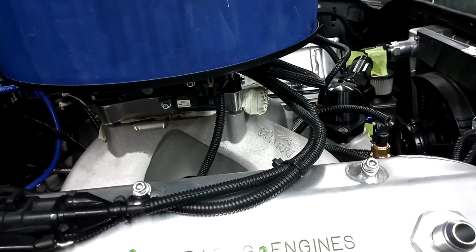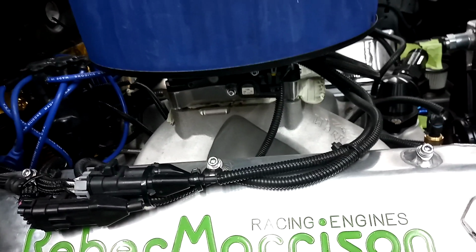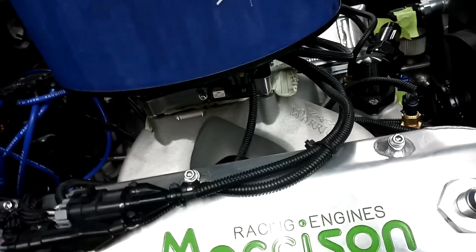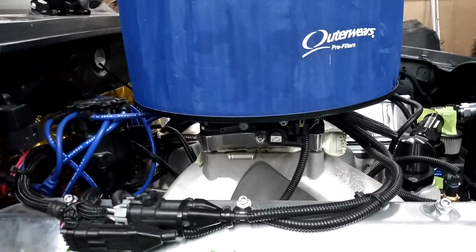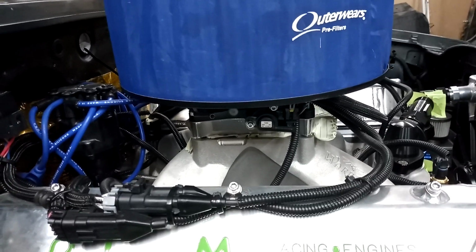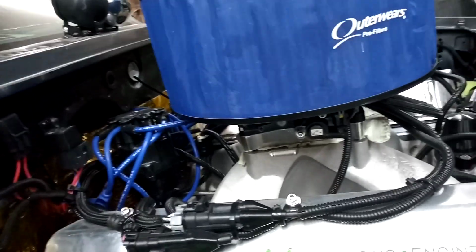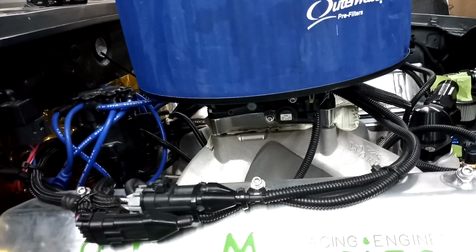Yeah, it's good. This damn thing carries 60 pounds of oil pressure just winging it over with the starter. So, and it's got a Melodon pump in it, so hopefully we don't have any problems. Everything should be good. I've went over the wiring like 4 or 5 times to make sure I had everything right. I did find one wire I missed. So I'll go over it again 3 or 4 times to make sure everything's good.